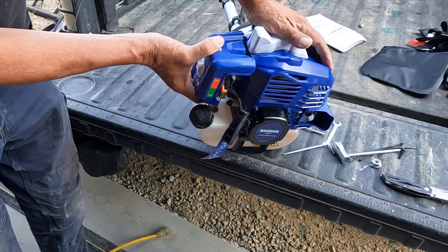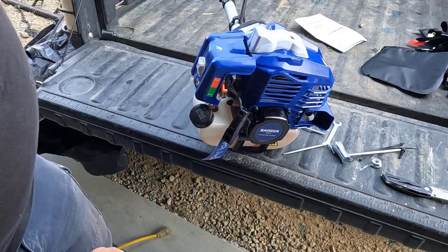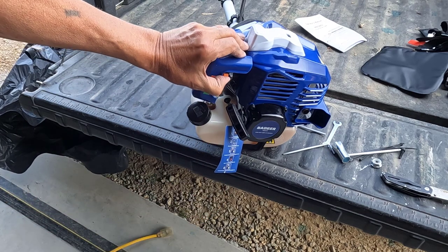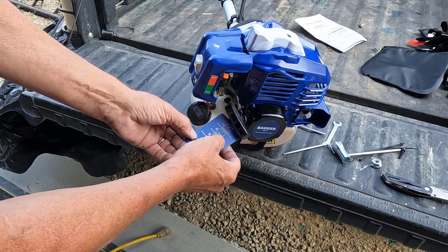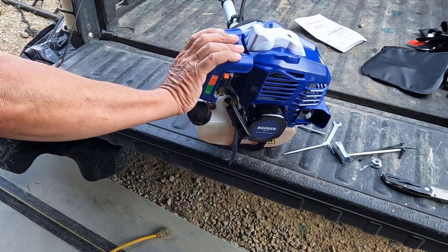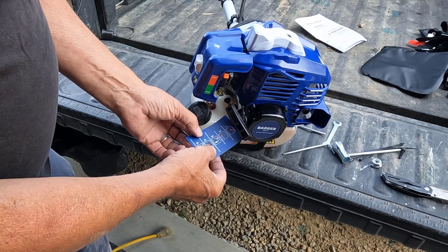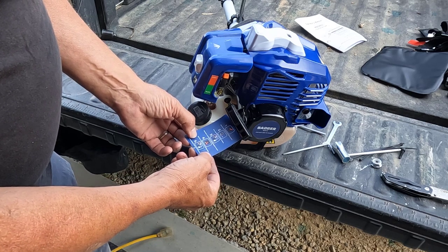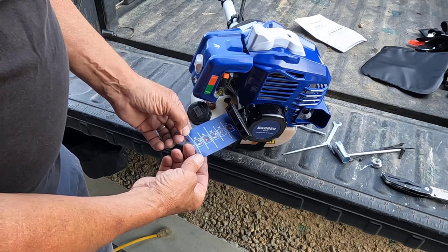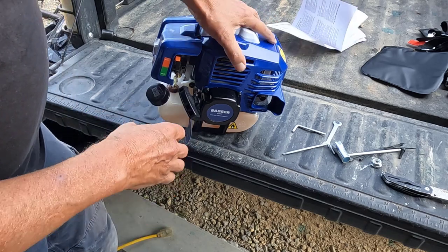I don't really like 50 to 1 — I guess that's supposed to be for air pollution, but they use the oil for lubrication. This cap is real cheesy plastic; I hope this thing doesn't leak. I'll give this 10 pumps. Got the carb filled. Alright, we'll read their starting instructions: choke lever to the start position, 10 times with the primer — did that already. That primer is in kind of an unusual position, up under there like that. Pull starter cord three to five times until ignition is heard, move the choke lever to the run position, continue pulling until the engine runs.